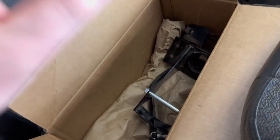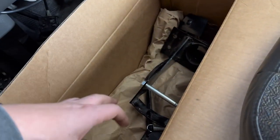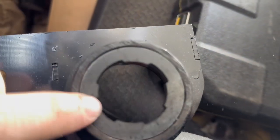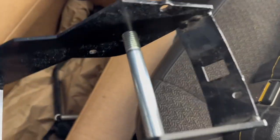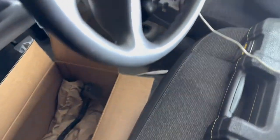We'll take a quick look at the new part, then try to rip the old one out, compare them side by side, and put the new metal one in. This is our actual mounting bracket. What has broken on my factory one is these little tabs — the factory bracket is plastic, and those tabs broke off, which lets the master cylinder just slide in and out. With this new one, you can easily take the pedal in and out if you ever need to grease it, and you can install it without the pedal attached, which makes it very easy.